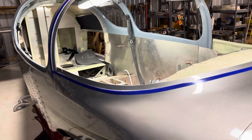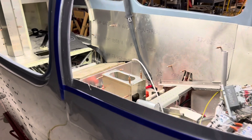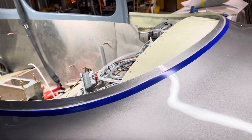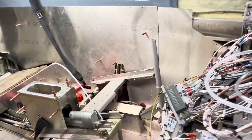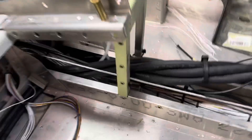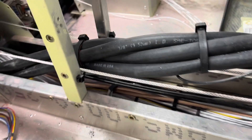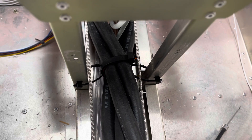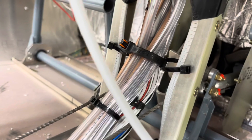A couple things I'm doing today. I am masking off the window to make sure that the SikaFlex does not get on the paint. This little vinyl tape roll works pretty well. Another thing I've been doing - I tidied up the lines. One thing I did here was to avoid any interference with the red pedals - simply just put in some zip ties on each side and secure to the middle. Worked out pretty well, did that there, as well as up here.